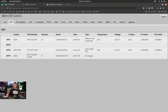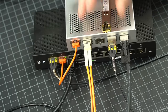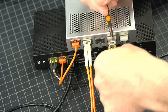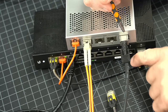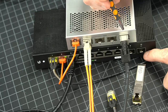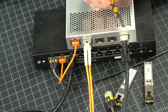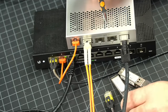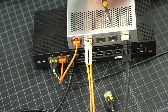I've got a whole breakdown of all these different modules that convert SFP+ to UTP and give you 10GB — I'll leave a link to that video. One thing I'll mention right away is this module right here: even though it will fit in a port, it won't do anything in this switch. If you want these to work, you have to get a 1GB one to put in a 1GB port. The 10GB ones won't drop down compatibility — the ones I've tried from different companies are 10GB and 10GB only, except they can negotiate down on the UTP side to a lower speed.